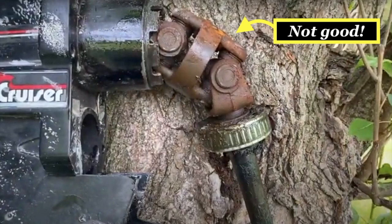One more thing — check this out: that is our gimbal bearing. Unfortunately, the boat sat so long that the gimbal bearing seated itself to the yoke shaft. As we removed the out drive, it was more stubborn than expected — the gimbal bearing had seated itself to the U-joint shaft, which is not supposed to happen. If it does in your case, scrolling above right now is a link to a video that shows us removing this exact gimbal bearing from this exact U-joint assembly yoke shaft. Definitely check that out.